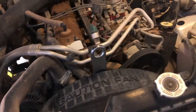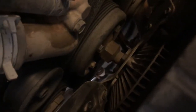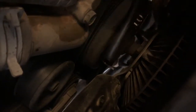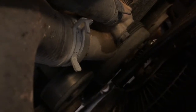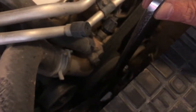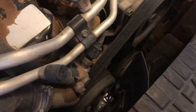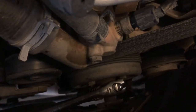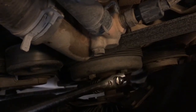The next thing we've got to do is get the fan off so we can get the shroud off. The fan clutch nut is right behind the fan in front of the pulley for the water pump. What you've got to do is get your metric crescent wrench — it doesn't actually have to be metric, get the biggest one you've got. Put it on the pulley. Jeep is righty-tighty lefty-loosey, so turn this thing counterclockwise. What you'll probably find if you haven't had this off before is that everything moves together — that nut is usually very secure and the belt tension isn't going to hold it enough. This has been on here a while and you're gonna find that it's stuck.